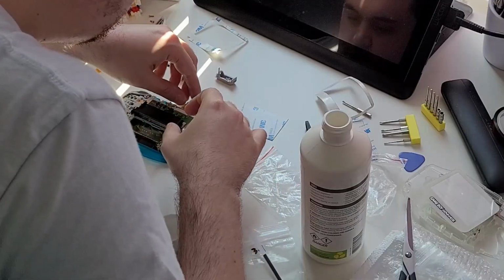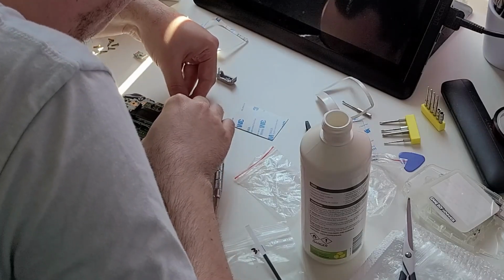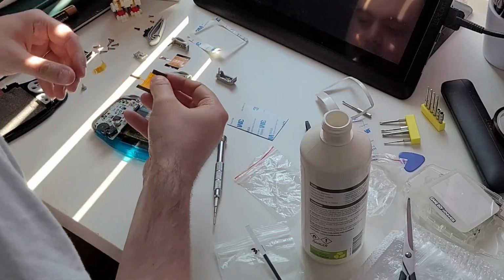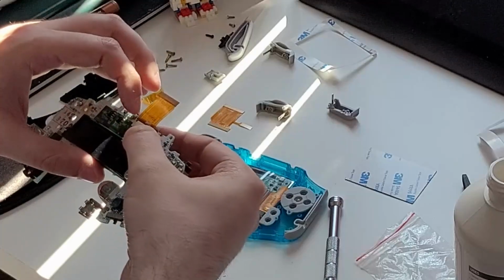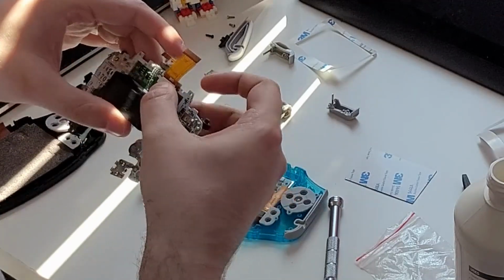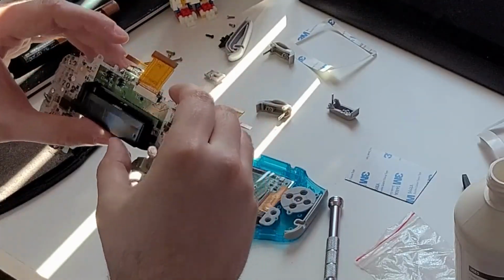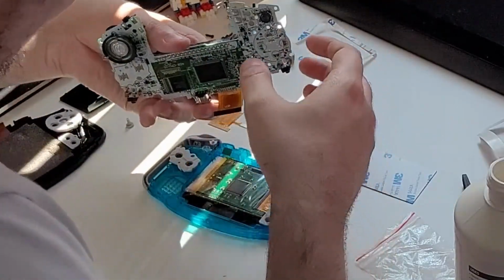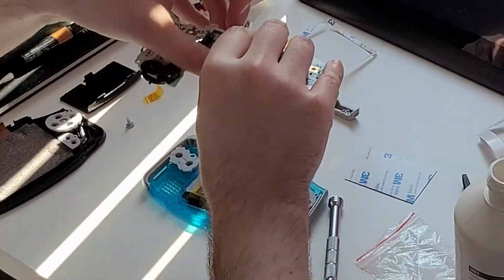I dropped in the motherboard and carefully tried to attach the 32-pin ribbon cable. This was my first clue that it wasn't properly latched to the logic board, as the cable just sprang right out. Even I knew that shouldn't happen. I then tried doing it the other way around, attaching the motherboard end first and then the logic board. Now, the GBA's motherboard has proper latches, which makes it very obvious when you have or haven't done it right. If only the logic board had this style latch too. Genuinely, I have over an hour's footage of me trying and failing this one connection.